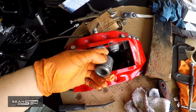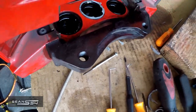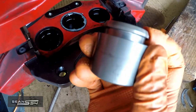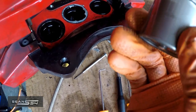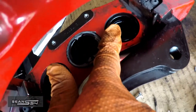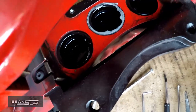I'm trying to pull the other two out by hand, which is nearly impossible. I already ripped one dust boot so I think I'm going to have to order another one. I managed to pull out the rest of the pistons using a little screwdriver and using the bracket as leverage, putting it on the lip of the piston and slowly prying it up. On the lip where the dust boot goes, you definitely don't want to scratch or mess up the piston. As far as the inner seals, if yours is leaking you definitely replace it, but I might not mess with mine because I don't want to create more problems.